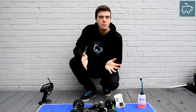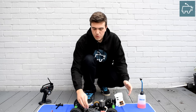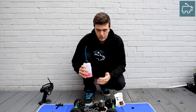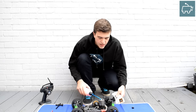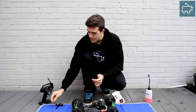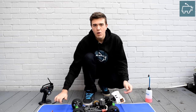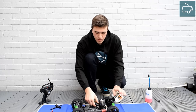While the glow plug is out and removed, this is where the special procedures begin to get the engine started after a long time. Usually to prime the engine you put your finger over the exhaust pipe and pull the pull starter, which forces fuel from the tank into the engine. What I'm going to do is give it a little helping hand — I'm going to take my filler bottle and while the glow plug is out, pop in just a few drops of nitro fuel into the top of the engine. Now we know there's some fuel directly below the glow plug, giving us a much bigger chance of getting it started. Once that's done, replace the glow plug back into the engine. Bear in mind there's already some fuel in there, so it will be very easily flooded.